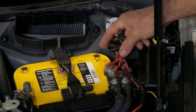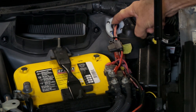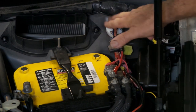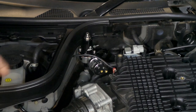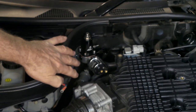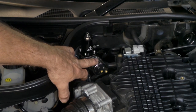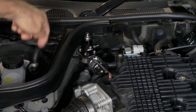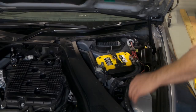Everything is now hooked up and bolted onto the battery terminal, fuse cable-tied in, the waterproof compression fitting reassembled, and the wiring for the electronic fuel pressure sender is finished — running through a grommet drilled in the side, behind the firewall, and out to the connectors inside. The fuel pressure sender is mounted onto the regulator; the thread needed cleaning up with a 1/8 NPT die first, and then the mechanical gauge is mounted onto the CJ Motorsports fitting.